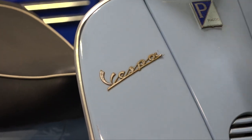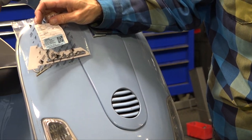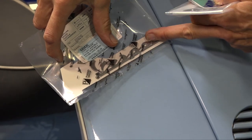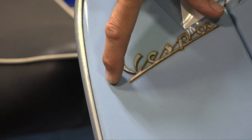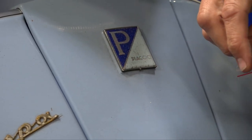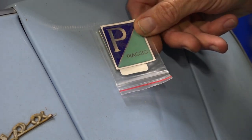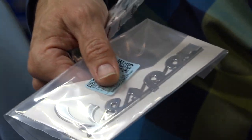On the ScooterWest web store, we have all these stickers and they're very inexpensive. For the front chrome 4-inch Vespa badge, the part number is 620530 — just search ScooterWest.com for that. Very simple to install. It's got a template that lines it up so you can get the 11-degree angle when installing it — keep it parallel with the edge and center it. For the Piaggio badge, you can either replace the whole badge at part number 576464, or just get the inexpensive replacement sticker at 576464-ST. For the large Vespa badge on the left rear cowl, the part number is 620529.